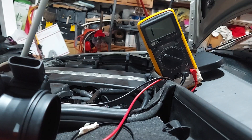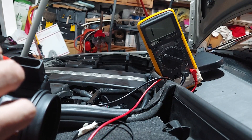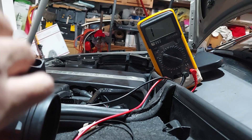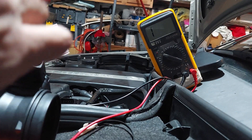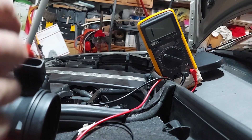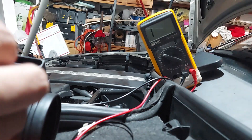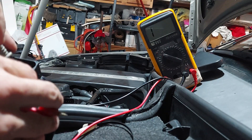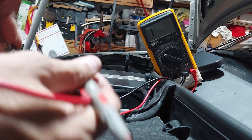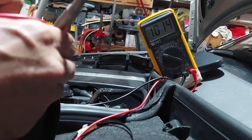Okay, let's switch them around. Don't forget the first pin on this car should be ground, or it could be signal ground. The second one is positive. So now I've got the black lead to pin one and the red lead on pin two, meter set on diode. And look at that - we get a nice, high reading.